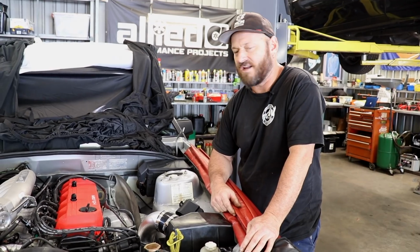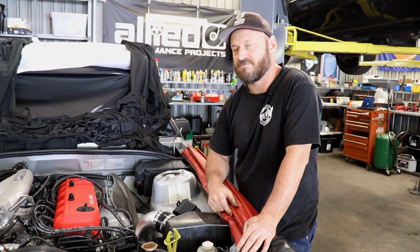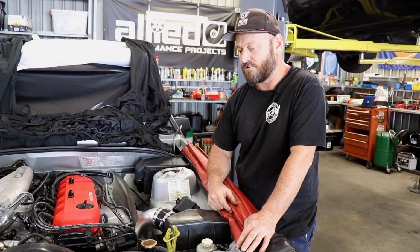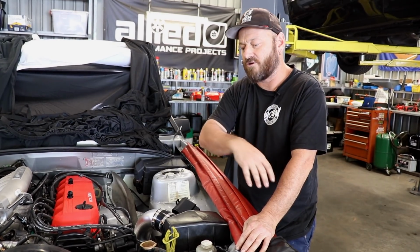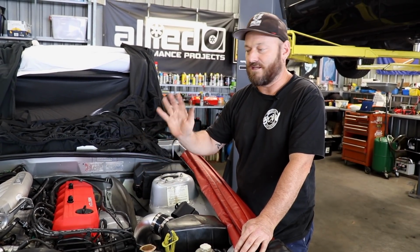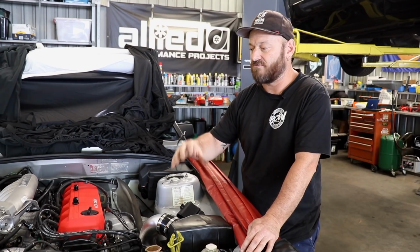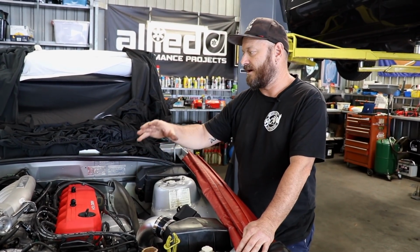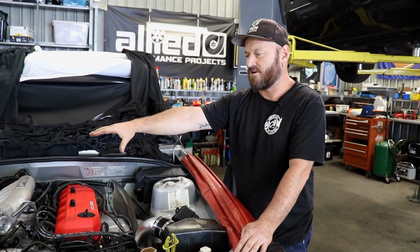If you get airlocks in them, it just will not work. The thermostat won't open. It'll overheat, it'll dump air out or spit water out. They just aren't that easy to fill up as they were in the 1960s because of modern systems. Mostly they have lower thermostats. They have potential air pockets.